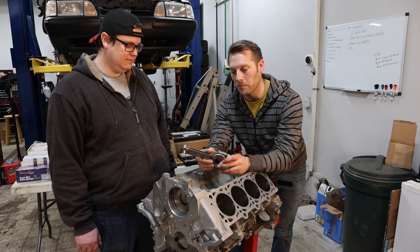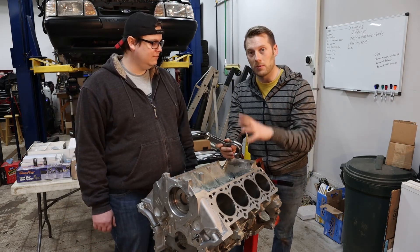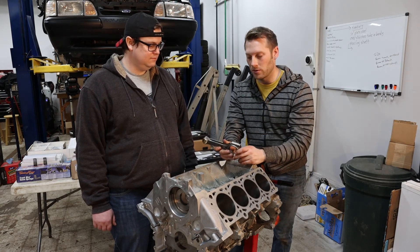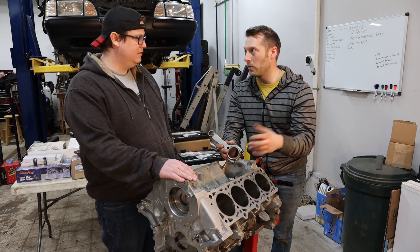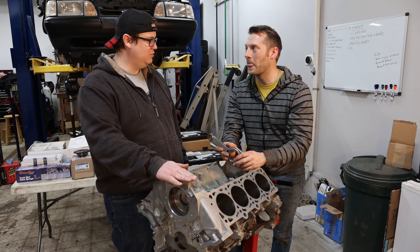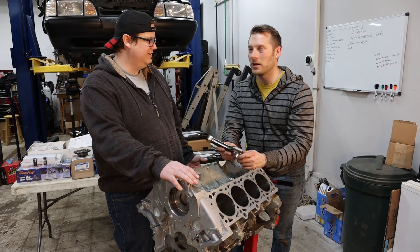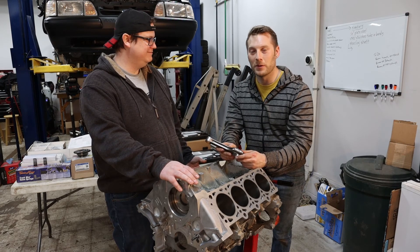This is a rod for a small block Chevy circle track motor. It has the small block Chevy rod pin at 0.927, but with a Honda rod journal size. In the circle track world they do that because it reduces the weight of the crankshaft since your throw is smaller, reduces the size of the rod, and you get less friction because you have less surface area in the journal. You would not want to make a thousand horsepower on this rod and bearing. These rods are actually inexpensive because in claimer classes they have to keep costs really low. We're doing this to the stock crankshaft — it's a much cheaper way to change your stroke and reduce the weight of the rotating assembly, turning a 4.6 into a 4.8 — essentially free cubic inches.